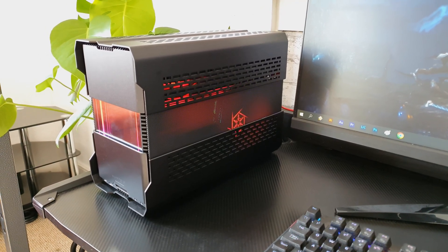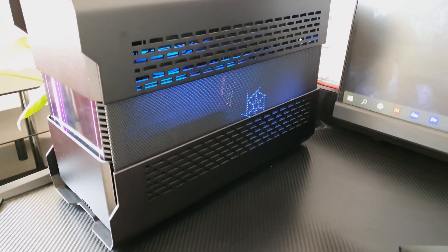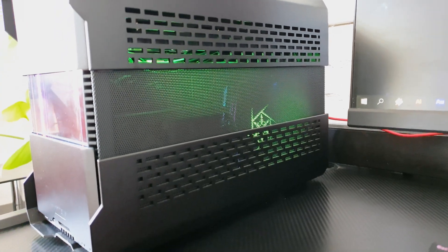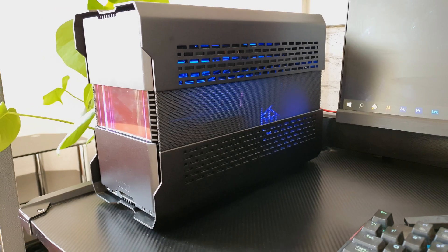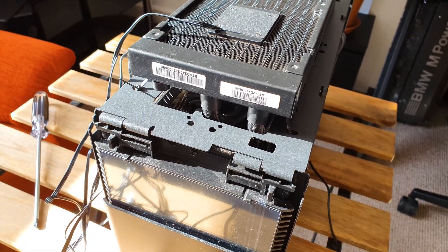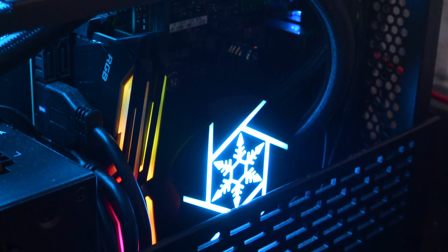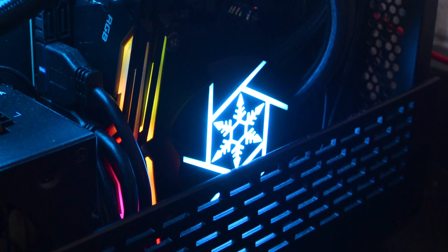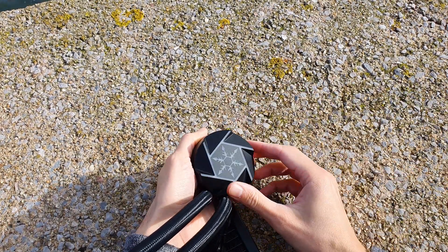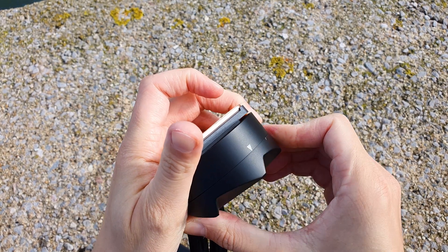What we have here is a calculated compromise for better fitment over a standard 240mm AIO. Luckily Silverstone managed to keep the balance in order and the Vida Slim still performs as you'd expect from a 240mm AIO — it did manage to keep my CPU under control in an overclocked scenario, which is plenty of proof despite the higher noise from the fans. The overall build quality is excellent, with a heads up that the included screws will not be long enough to clear a modular case-through installation as seen with the Phanteks Evolve Shift XT. Nice visual points go to the RGB implementation in both the slim fans and the low profile CPU block, and the rotating top cap. The thinner radiator and the extremely quiet integrated pump alone should warrant getting it despite its price tag, and you can always upgrade to fans of your choice if you want even more performance within the available space.